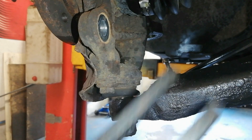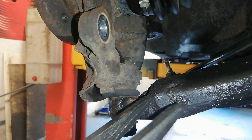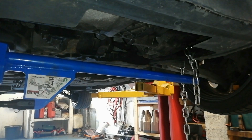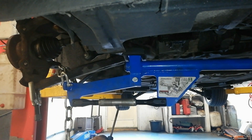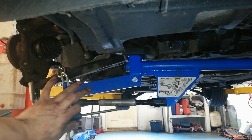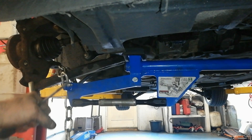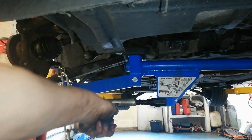If I was replacing that ball joint I would use this fork that goes into the air hammer and I'd just blatter that and get it off in seconds. But I'm not going to do that because I want to reuse this. So we don't want to put anything in the boot for this. This blue bar here is my buddy - this is known as a third hand suspension tool. It was actually a wee bit too long for this Mini, so I wrapped a bit of chain around the far end and hooked it on. Over here is where the action is - it's chained around the wishbone. We'll put a wee bit of tension on it - this is just going to put tension on the wishbone to hold it down, like having somebody else prying down on it with a pry bar, but this will hold it in that position for the whole duration.